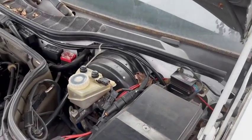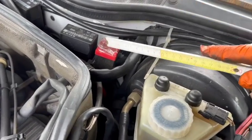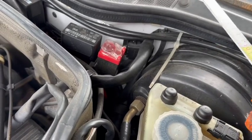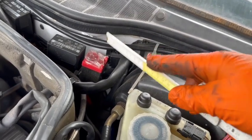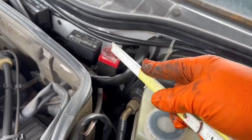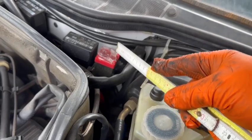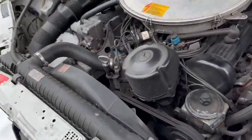If you're anywhere close to 3000 RPM high idle, it's most likely the over voltage protection relay. This is also true for diesel — the diesel will just go into low RPM. On newer models it has two fuses; on older ones just one. Your ABS light might come on and it's going to go into high idle. Make sure the fuses are okay and make absolutely sure you get the correct over voltage protection relay, because the wrong one will cause incorrect idle.